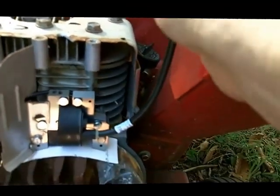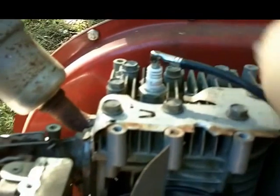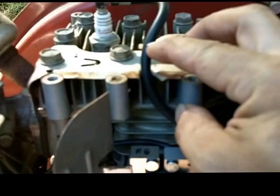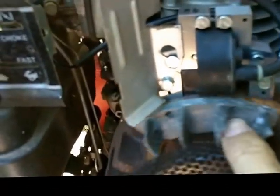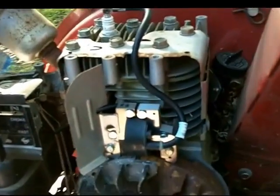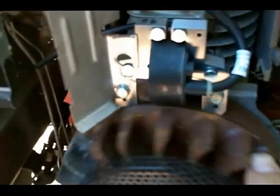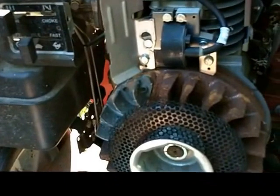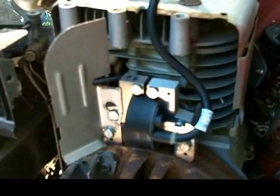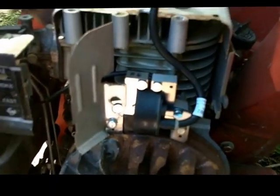That's tight. Here's our spark plug wire that's going to come up and connect to our spark plug right there. It fits in this little groove when we put the cover back on. Now you can spin the flywheel and that card will slip out. Turn your flywheel and make sure it does not rub against the coil — everything should be spaced properly. And that is the new magneto installed. Really not all that difficult. I hope this video has been helpful. I appreciate you watching. Please feel free to leave a comment if you have one.